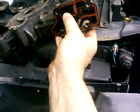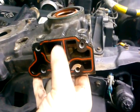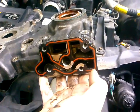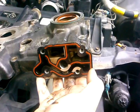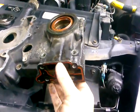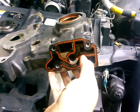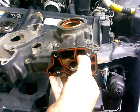This is where the oil gets drawn in, right here on the side. This is normally where your oil pump would be, depending on if it's a front-wheel drive or rear-wheel drive car. They'll all look different, but the housing is all the same. This is where it pulls oil in, and this is where it pushes it out — it goes to the filter after it's been run through the pump.